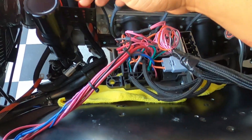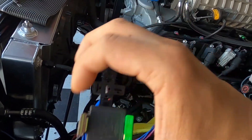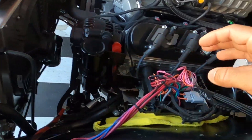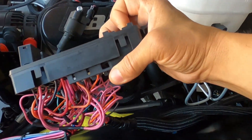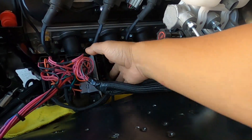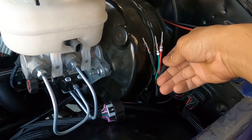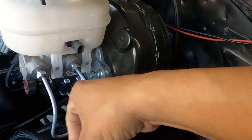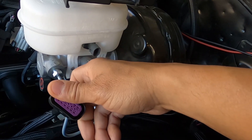That's really what we had to do to make sure everything works together. We added the fan relay, we added the trinary switch — you really have to do that. If not, you're going to have to run separate relays somewhere close to the front end. Let me put this box back together, mount it, and then we'll go over the wires from the transmission controller and the outputs from the GM harness — the ones you can and can't use.